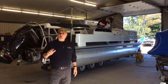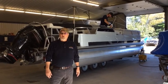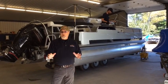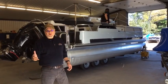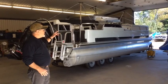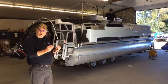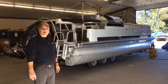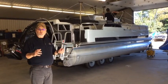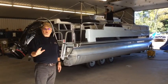Not all people shrink wrap the same. We have developed our own way of going about it and some things that we do are a little different. We see a lot of new boats come in that have protective coverings on them. We feel that's necessary to keep the finish on your boat. You see the boat behind me — it has a nice glossy finish and we put a white protective film on it. It's really low tack so it doesn't bother decals or anything. But if you get some wind during the winter and the shrink wrap moves a little bit, there's very low likelihood that you're going to have any chafe marks on it.